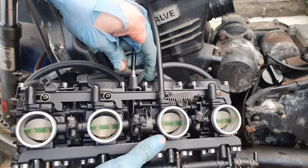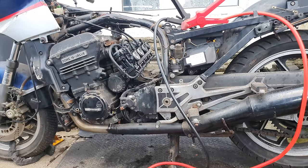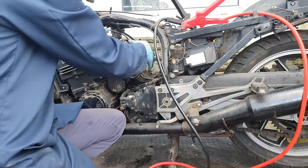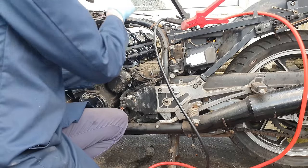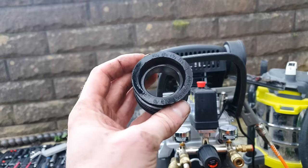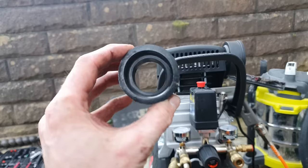And that goes in there. Then that bit, yes, done. That was tricky. Now, obviously, because I've routed the throttle cable the wrong way, the carbs don't fit inside there. So you're gonna have to thread the throttle cable through there and then awkwardly try and do it. Ash's top tip of the day, put these on the carbs before you push it onto the engine, much easier.